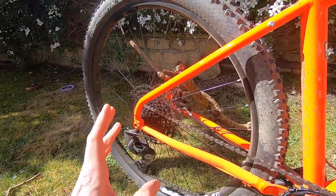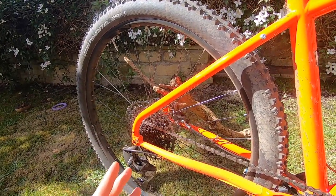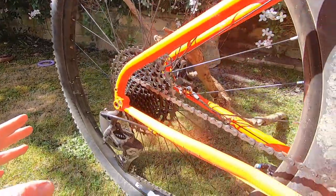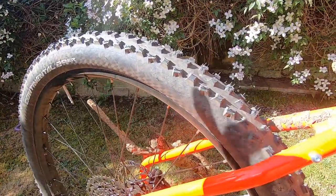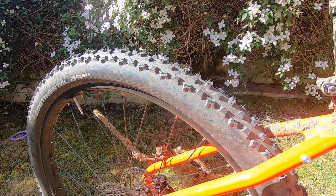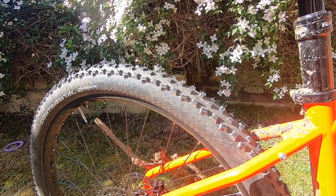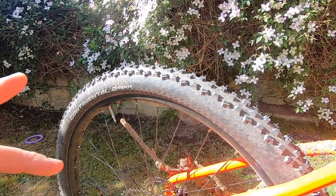The bike came through with V Rubber Flow Snap e-bike tires — super sticky so traction is awesome, but they really killed the ride quality. I swapped them for Continental Mountain King 29er tires: folding bead, 2.4-inch, in the Black Chili compound — really fluid 29er tires at a good price since Planet X buys older stock. The only downside is older Contis are a swine to set up tubeless, so be patient.